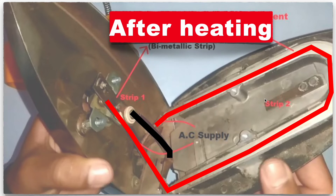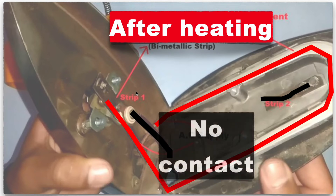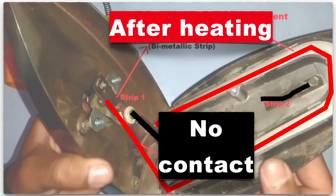Once the iron has heated up enough, bimetallic strip two will start bending upward. Since it is bending upward, it will push bimetallic strip one upward as well, removing the contact from the bottom of the thermostat that is connected to the neutral wire. This breaks the loop of electricity, so no electricity will flow through the coil.